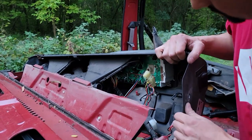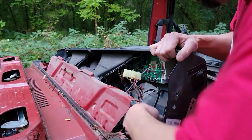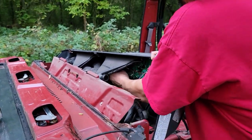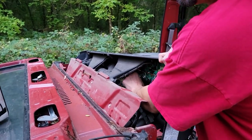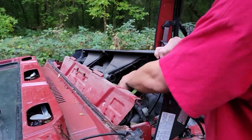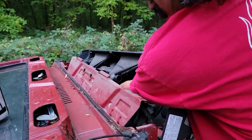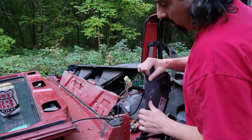Now you can start pulling back. If you want to clear up some space you can pull out your heating tubes, toss them out to the side. Now you're going to get down to your wiring — just start popping wires out and pulling all your gauge cluster wires, really starting to get things freed up. There's going to be little metal tabs wrapped around the wiring harness and the loom going in the back, so you're just going to keep following this wiring harness. When you get to a metal fold-over tab, just untwirl it so the wiring gets loose.